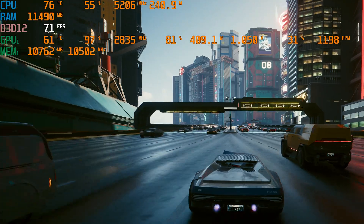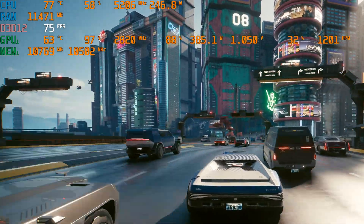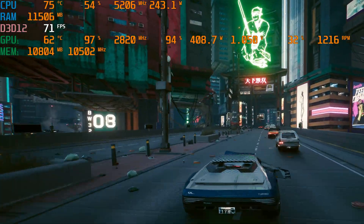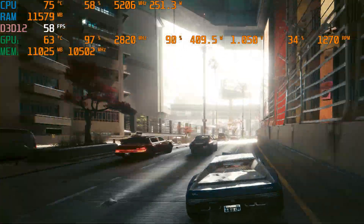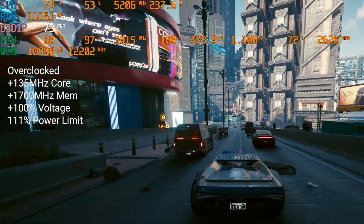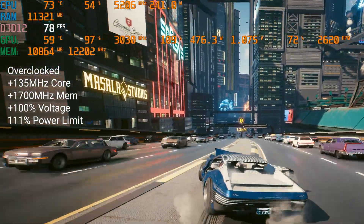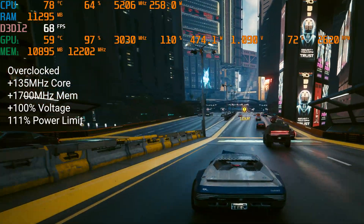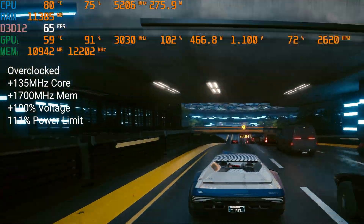For power consumption, this graphics card stays under 400W most of the time in most games, and only goes over 400W in ultra-heavy games like Cyberpunk — and even then it's just barely. Clock speeds stay at over 2800MHz and temperature stays in the low 60-degree range, with fan speeds barely spinning at just over 1000 RPM. During overclocked settings, hitting just over 3000MHz, it's actually consuming over 400W, and with voltage bumped up to 1.1V it does sometimes hit the 500W limit. But with increased fan speeds, even the higher clock speeds don't increase the temperature that much, showing the cooler is really quite capable.